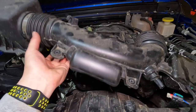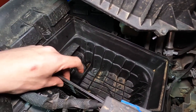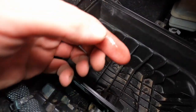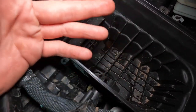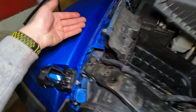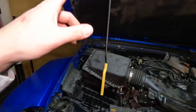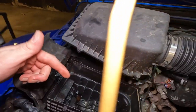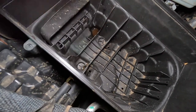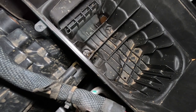Now we do have to remove the air box. Before we do, you can see there's already a bit of liquid in there. I did take it through the car wash, so that's probably from that. But you can see just from taking it through the car wash, water does get in through this intake. It will also get in through the snorkel, but the snorkel has an actual drain that's a little bit better than this. These do have drain holes in the bottom, but if you actually go through a deep enough puddle it will suck water in.